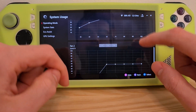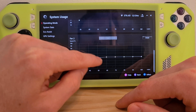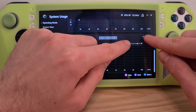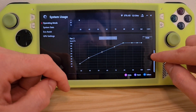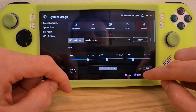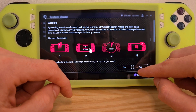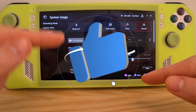I like to keep it a little bit more aggressive so I don't overheat my APU. Once you have all of these set and customized to your liking, go above again and hit apply, then confirm the warning. Now you know how to set fan curve on the ROG Ally.